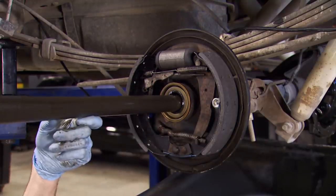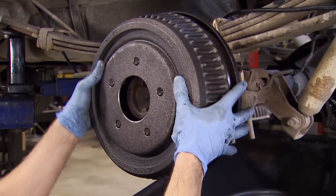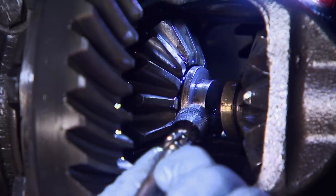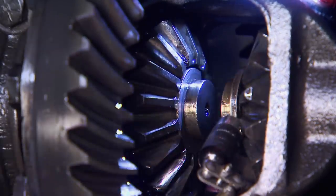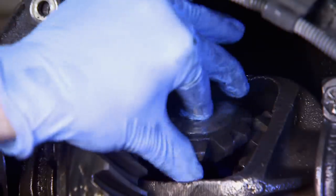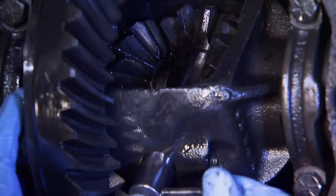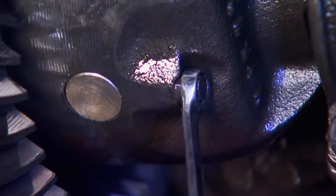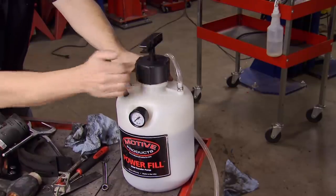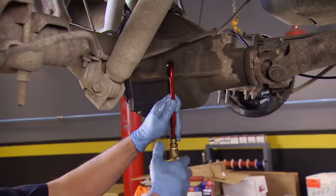Make sure you don't catch the sharp splines of the end of the axle shaft on the seal causing damage. With the axle shaft pushed a little further than its normal seated position, it easily exposes the grooves for the C-clips, which can be inserted again with a magnet, and the axles pulled back into place, ready for the spider gears. You've got to time them so they're parallel and line up with the bore for the center shaft — a couple of stabs usually gets it right. Then insert the retaining bolt, snug it up, and you're rocking. With the diff cover sealed up, we chose to let compressed air do the work using the Motive Products power fill rather than the forearm squeeze of the quart jugs.